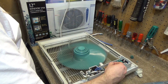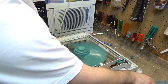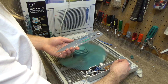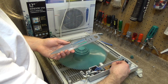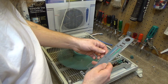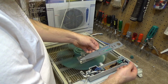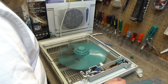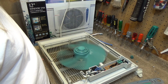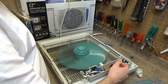So it switched over to automatic. And now it's working. In here it's 73 degrees now. As we call for more cooling, it seems to turn itself up. And that's where it starts to change. That's right in between 65 and 85. And it goes down even more. It's kind of working inversely to how I would expect. I would think if it's hotter, the fan would run faster, and then as it gets cold, it should run slower.